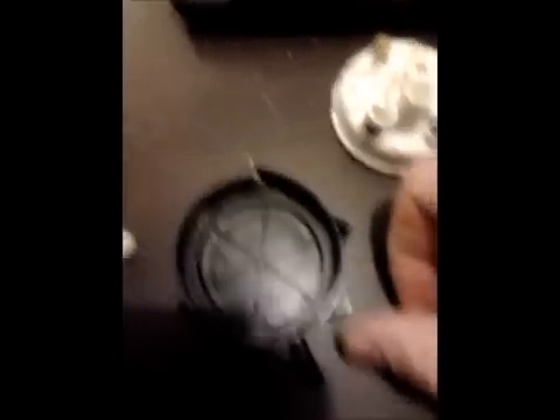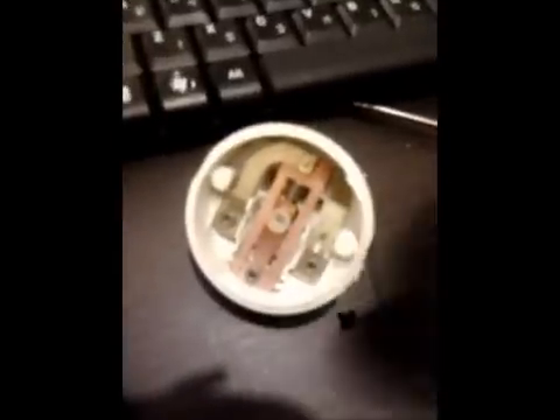I could open it up, but I don't suggest you to do that. After you see this video, you can play with the screwdrivers first and see if the pressure switch works fine, because it's not so easy to open it up. I broke it a little here — I hope it won't make the air leak out from the casing. Also, inside there is a diaphragm which presses the switch and causes it to change its state.